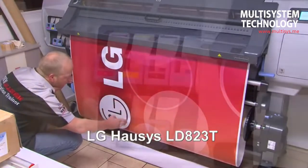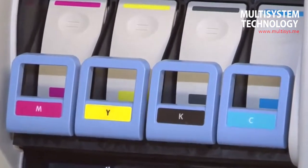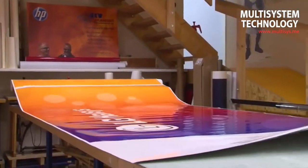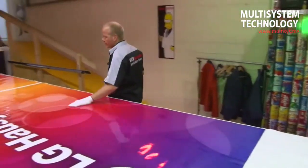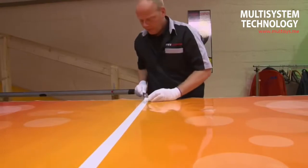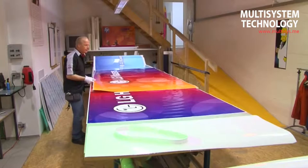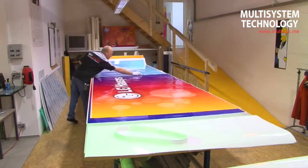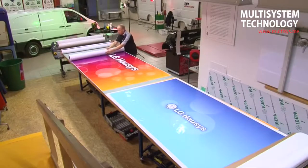As a result, the drying time of 24 hours needed for solvent printing is not applicable. Before they are laminated, film printed with solvent inks should be dried either rolled out on a drying table or in special drying chambers which guarantee air circulation. The film should never be dried rolled up or standing perpendicular on the ground. Otherwise there is a danger that the solvents on the inside of the roll of film accumulate and alter the adhesion characteristics.